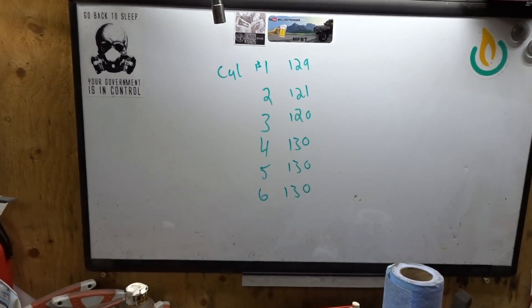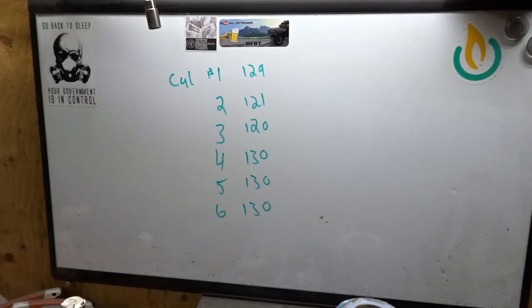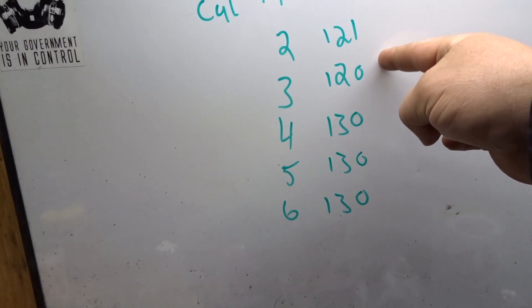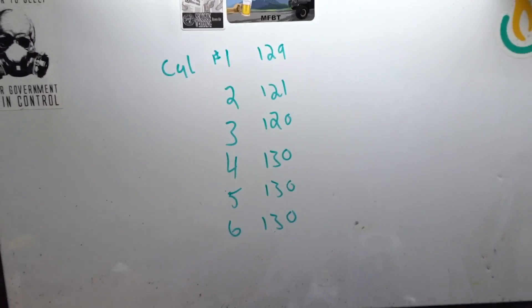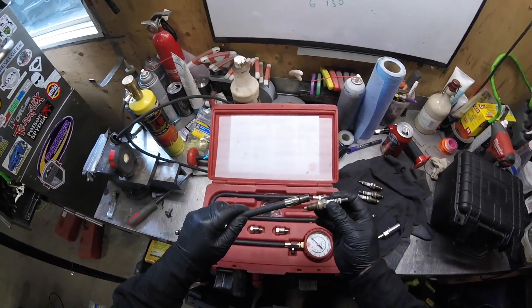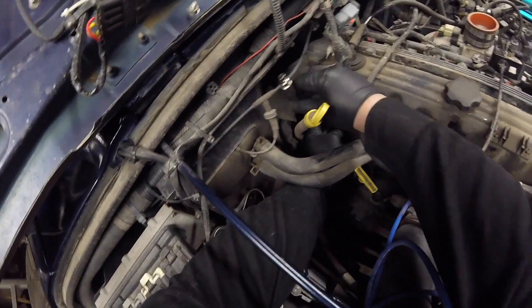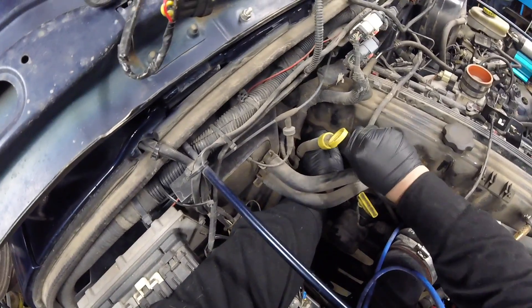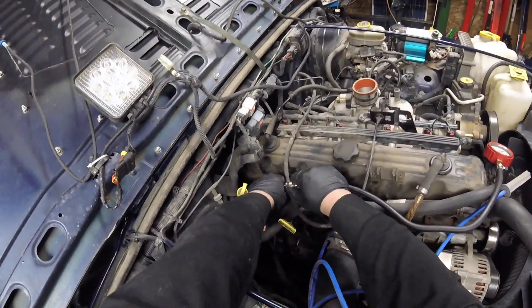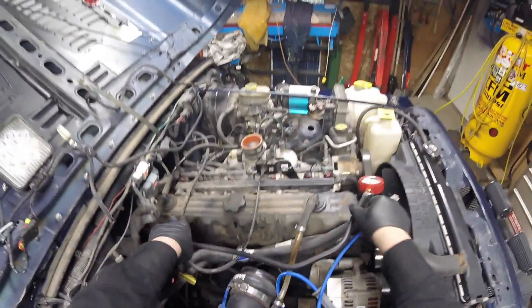During that time, the last four years this engine was also supercharged for a period of time, adding more stress to the engine. Let's get set up and see how much has changed. The compression in the Jeep should be between 120 and 150. Four years ago, cylinders two and three read 121 and 120. Here's the Mac Tools compression tester I picked up quite some time ago — it's actually worked really well. Let's get this fitted into cylinder number six for starters.